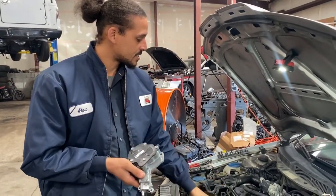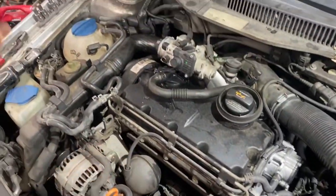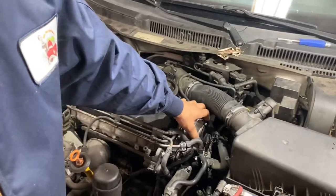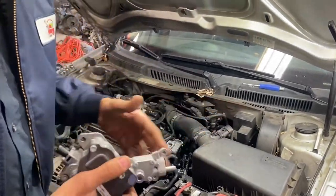This particular motor is the BW TDI — that's the engine code BW. That's just the design of the motor. Instead of the old design which has the high pressure fuel pump right here, the BWs moved it right here. And it's also the vacuum pump for the brake booster.